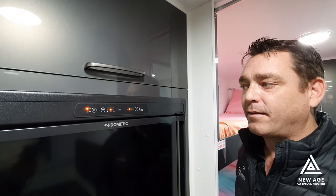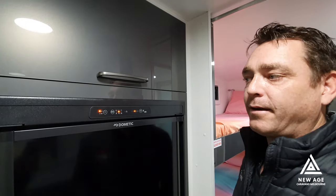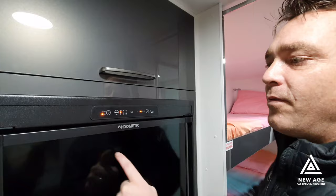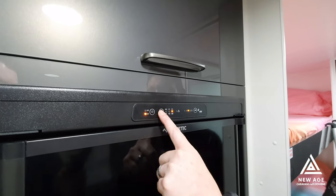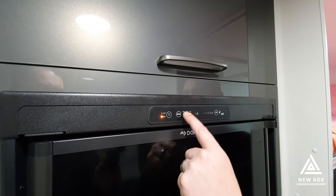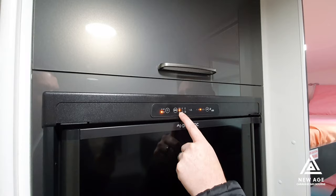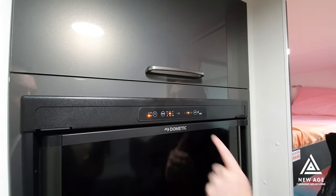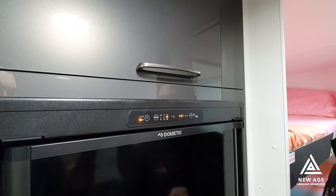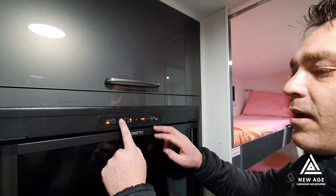We do have a little regulator here at the back that will light up red and tell us if we're overheating. Although the automatic setting is the way you want to use it, if we hold the mode and the set button, it will take us back to the manual setting, in which case we can choose whatever we want and there is no shut off. So here it will actually recognize — even though I haven't got a car plugged in — and say okay, you want to use the car battery? At the moment I've got gas and 240 volt, so nothing's flashing. But you will notice that as soon as I go to the DC setting, this will start flashing at me saying the fridge is not working because there's no DC charging. So anytime this fridge flashes at you, it's a good idea to check what setting you're using.